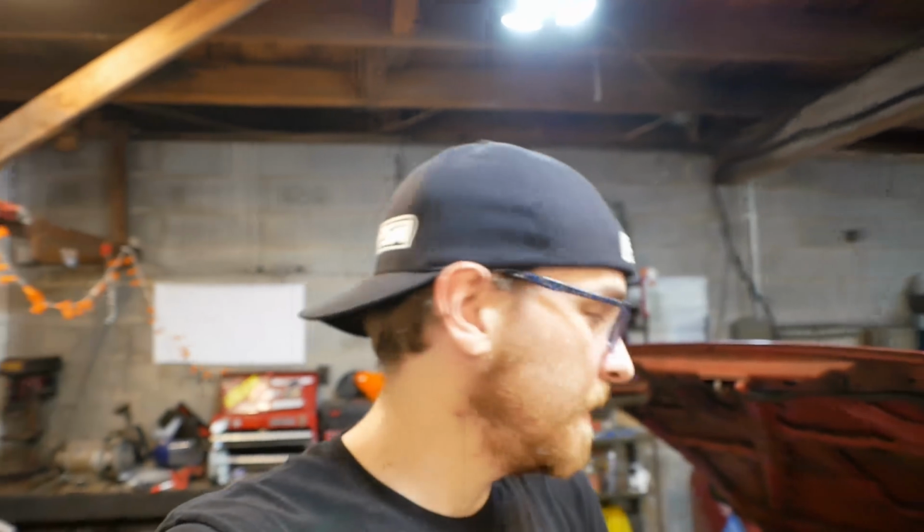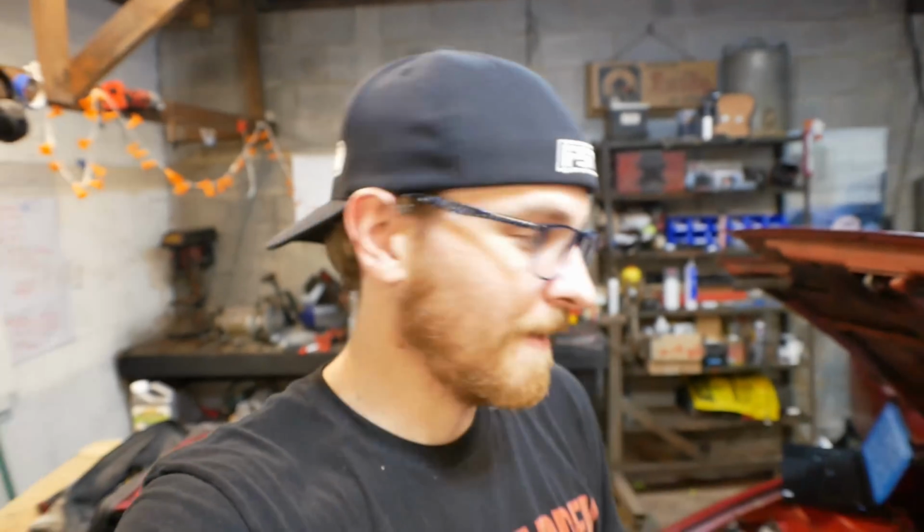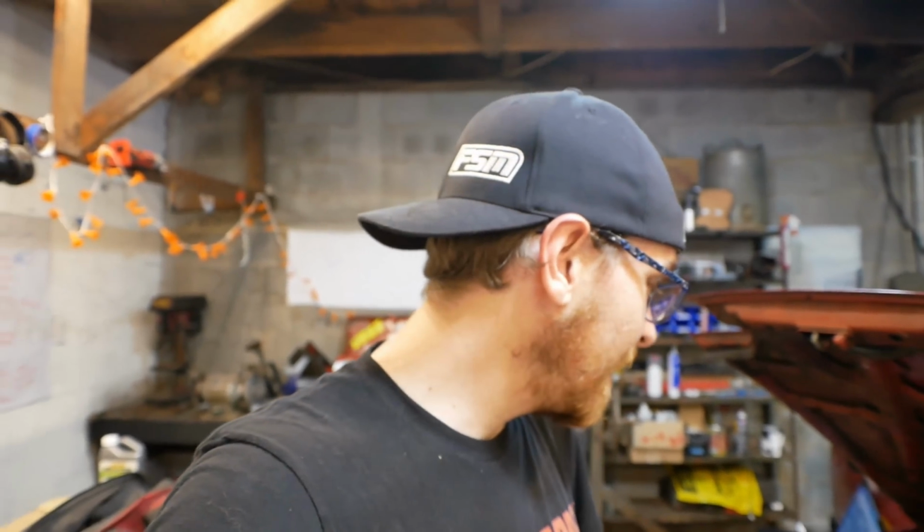All right, well, I think we're ready to begin actual testing here. Testing isn't going to be quite as exciting as getting the car running because although we didn't have any great success last time, I did learn something new about the powers of my ECU. It has a test output mode that can allow me basically to fire the injectors or fire a coil on a non-running engine. And with that, we can test these coils to see if they are configured right, see if they're wired right, see if we get unexpected smoke, and as well, see if they are actually sparking.